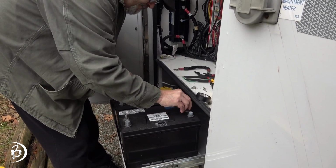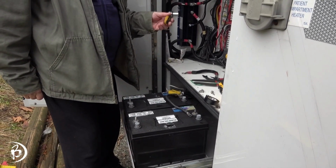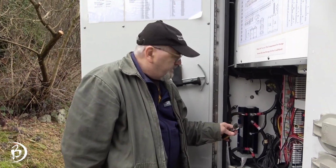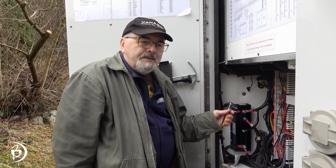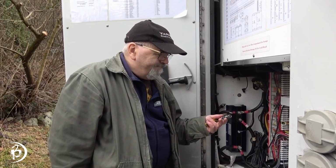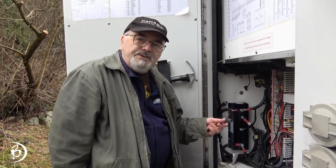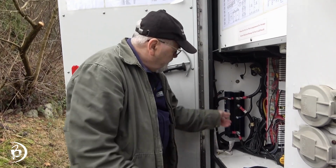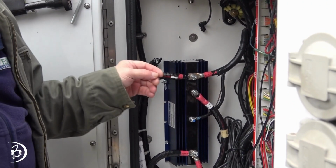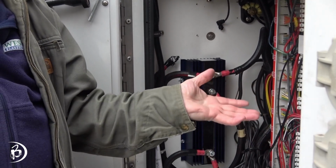Trust me. I should have been recording this, but we've had a professional electrician. He's worked 15 hours on this so far, just to reconnect some of the wires that the, I'll call it, de-installers use when they're taking all the ambulance lights and the sirens and all that off the ambulance. So we put this on, which is an isolator, and that isolates the power from the cab that comes into the back. We call it the house.